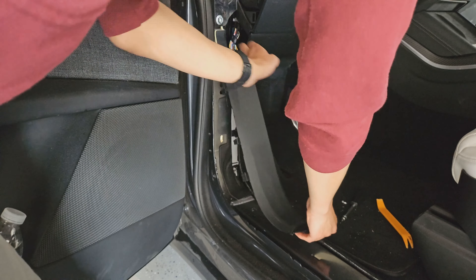We need to look at the connections behind this carpet, so pull back the carpet — it just sits against the car. Once you're inside here, you'll see this big white clip. Behind it, use your finger and press a little tab — it releases the lock — and then simply pull the two connectors away from each other. Now you have it disconnected.